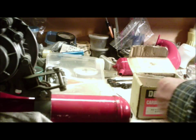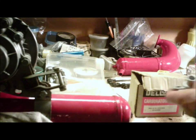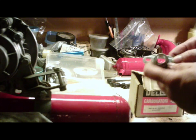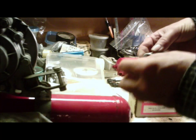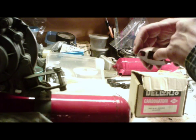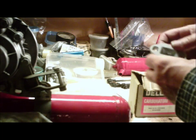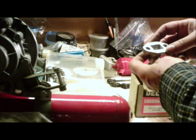In theory, everything should go together well. However, one issue with the intake is that the inside bore of this intake is not 15mm. It starts out at 15mm and it's down to about 13mm right in the middle. If you look down carefully, you'll see that there's a line in the middle — that's where the two halves of the cast thing fit together. So it's got a slight taper this way, and going from the rectangle side it's got a slight taper going towards where it turns into round, and in that little spot it's a lot narrower.